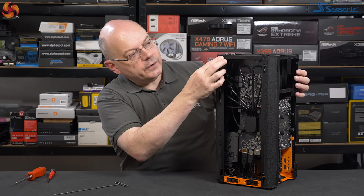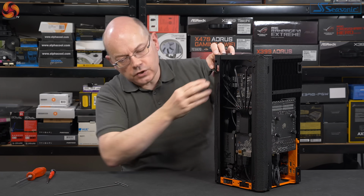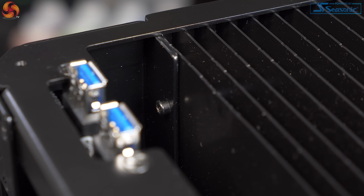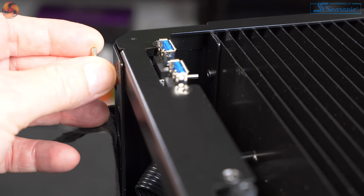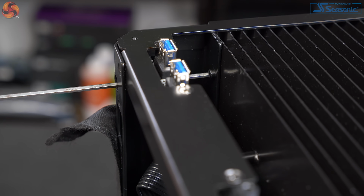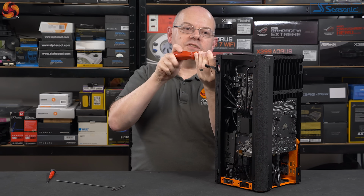It's quite straightforward that there are screws that you have to remove. But through these access holes there are also some tiny little cap heads. They're 2.5mm Allen keys, so that's an M3 screw. But a regular key is too short to reach, so you have to use something like an Allen T-bar. So that's mildly frustrating. So I'm going to do a bit of dismantling and then I'll show you what's going on further inside.